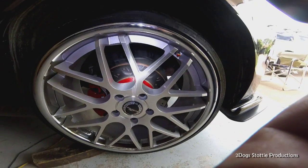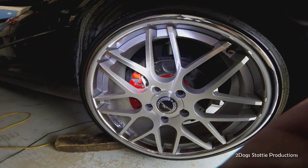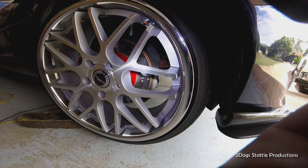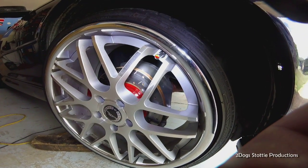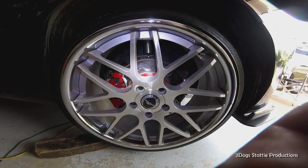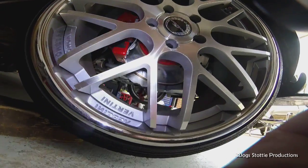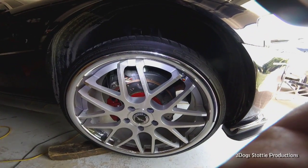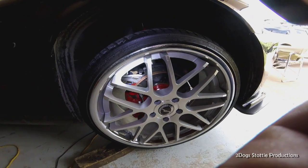This is the standard brakes on this E46 BMW - different rotors but the pads and calipers are basically standard. The rotors are DBA drilled and slotted heat-treated sport package. We're going to upgrade that to a big brake package from ECS with Brembo pads and four-piston calipers off a Porsche 996 Boxster, with radial mounting adapter brackets from Rally Road in the US.